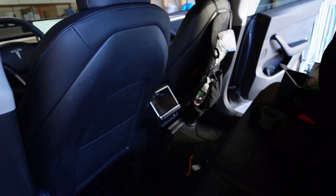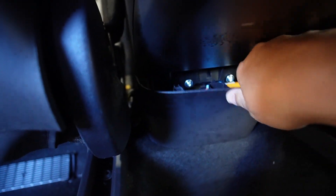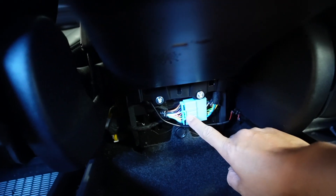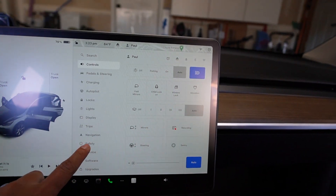Let's try to install the new instrument cluster display from Temu in my Tesla Model Y. First thing first, you have to remove the panel just right below the rear center console of your Model Y — this one right here. I kind of loosened it, but if it's too tight just use one of these removable plastic pry tools. There you go — we'll pop it right out, and then we'll access this 26-pin rear OBD port right here. But before you unplug it, I suggest to turn off the car first. Power off the car — just go to your main menu, then safety, all the way down, power off.